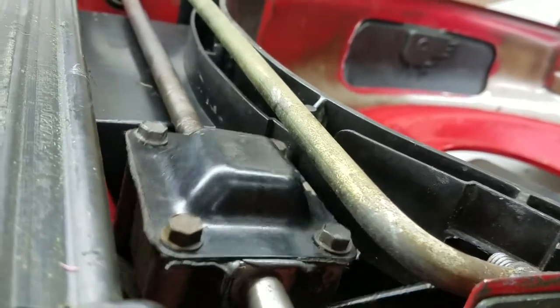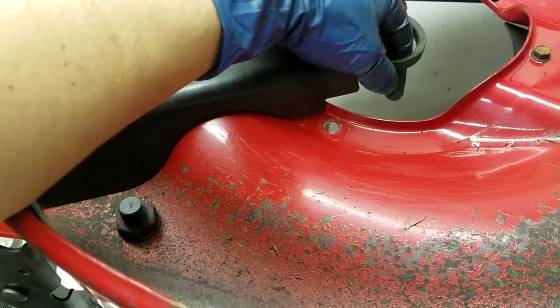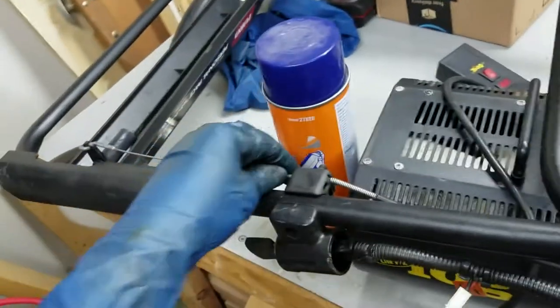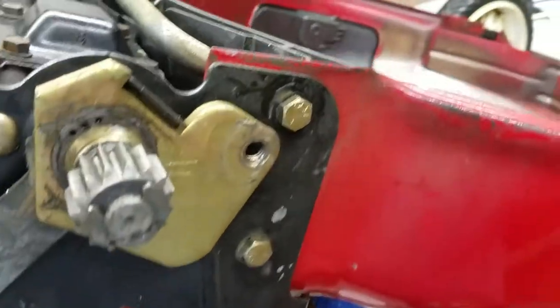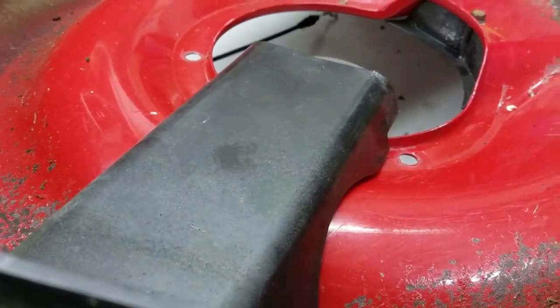You can see what happens when I do that - the whole gearbox rotates, and it's actually mounted on the shaft itself that drives the wheels. Once that engages, the belt gets engaged to the crankshaft. I've seen these belts get stretched and dried out and cracked. Usually what happens is you only get a little bit of assist. Even if you adjust it to make it tighter and you have it engaging at a quarter inch depressed, it still doesn't give much assist. If I pull this gearbox down, it actually bottoms out into the cable. A lot of times it'll be stretched to the point where you can't adjust it anymore - you're just barely getting the slack out of the belt. If that's your problem, it's definitely going to be a belt problem.